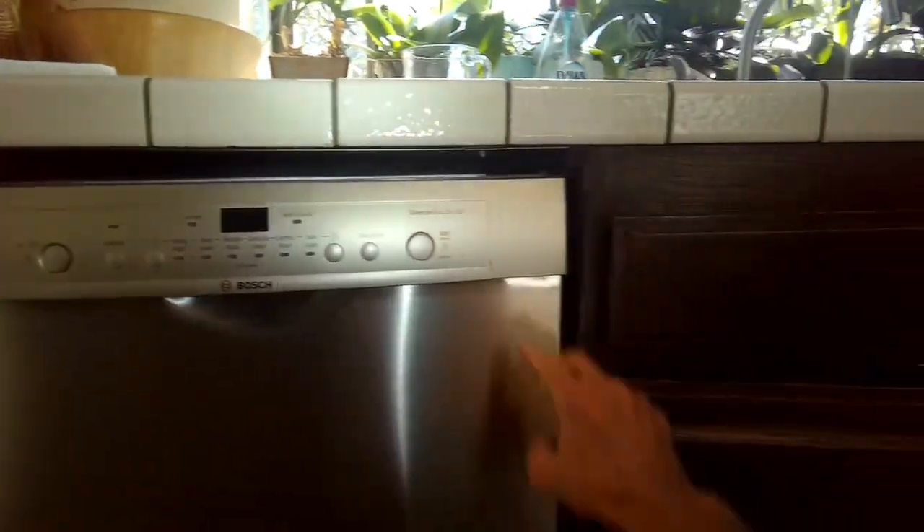I'm going to pull on my drain hose a little bit to get more of it through, and a little more on my power cord. Sliding the dishwasher back in, I want to make sure the sound insulation is nicely in position and not getting snagged on anything as it goes in. I want it to go higher to fill the gap, so I'm going to raise the feet. I'll tilt up the dishwasher with my hand and spin the feet down — they're pretty easy to spin out. And in the back, I'll use a wrench or screwdriver to turn that one too.